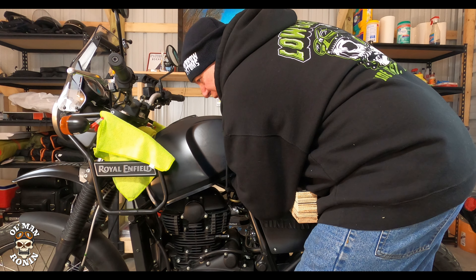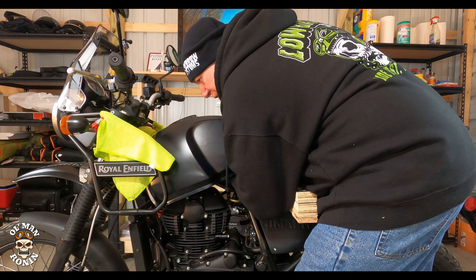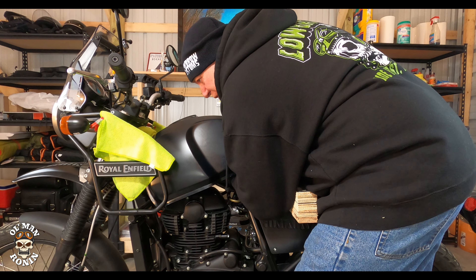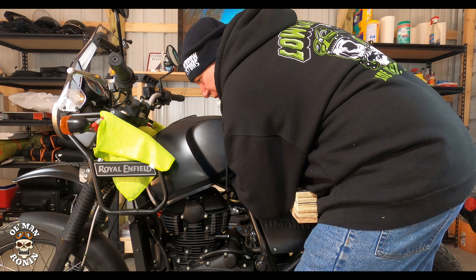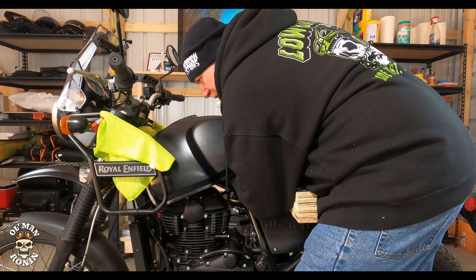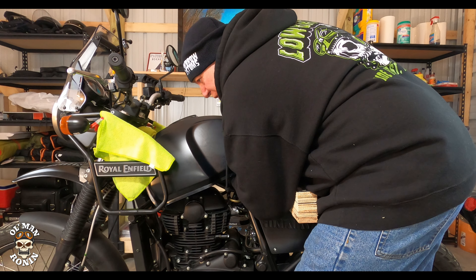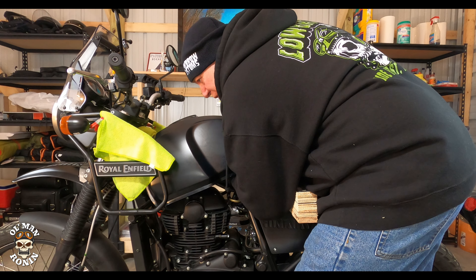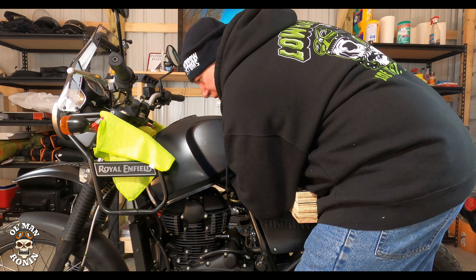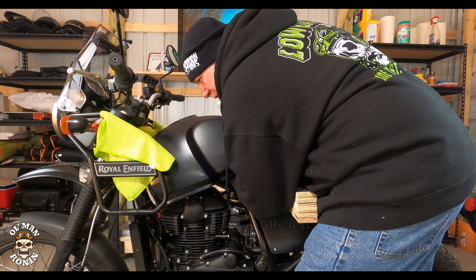Here's a close-up of the connectors. The blue connector is on the left side of the tank interior. The vacuum line without the clamp is also on the left, and the vacuum line with the clamp is on the right. On the other side you have the fuel pump connector and the fuel line. This is also the rubber mounting hub that the tank sits onto, and it bolts down on those two holes. On the back of the tank, watch those rubber washers — they can fall off, so make sure they're against the bottom of the tank when reinstalling.